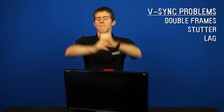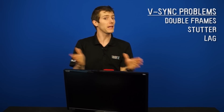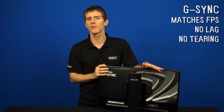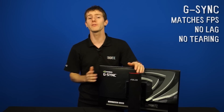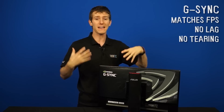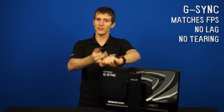The other problem with V-SYNC is the lag. Many gamers — Google it, V-SYNC input lag — find playing with V-SYNC completely intolerable and are willing to just put up with the tearing that occurs from turning it off, for the sake of not having to deal with that lag. So G-SYNC updates the screen exactly when the frame is finished and ready to be output by the graphics card, whether that's 55 FPS or 60 FPS or whatever it may be. So the refresh rate of the monitor acts as an effective maximum, so you don't get the lag and you don't get the tearing.